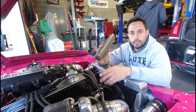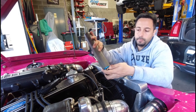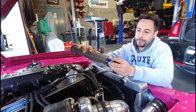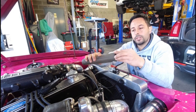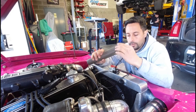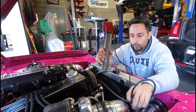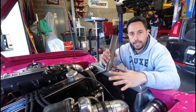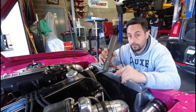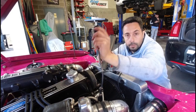I've got my old-school national timing light — an old beast powered by D-sized batteries. It doesn't have the fancy features of my newer one, but where this one excels is looking at timing at cranking speeds. It is wonderful because it's self-powered, has a good light, and is really good at picking up RPM signals at very low speeds. I've got it clipped on to my number one lead.